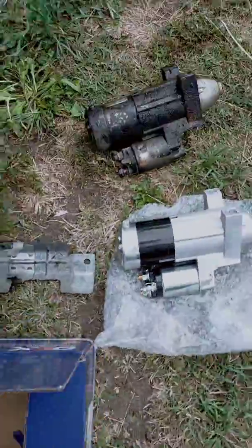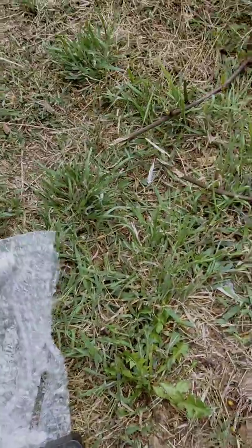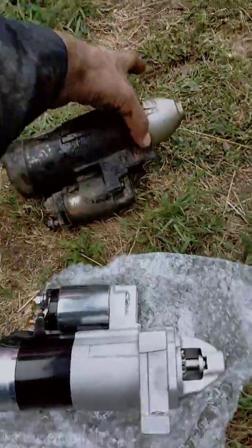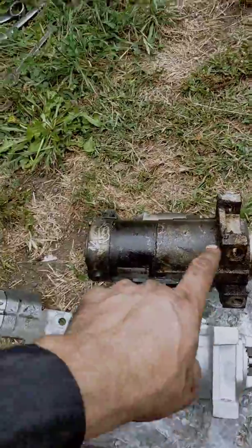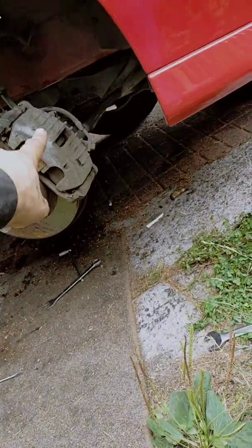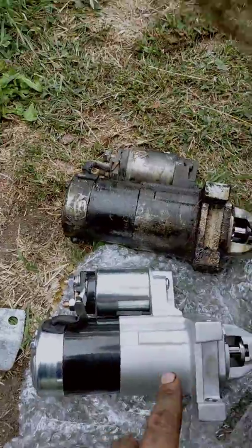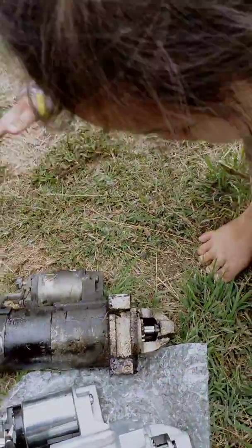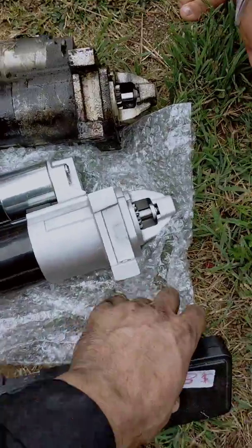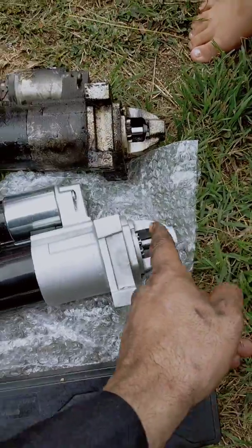A lot of the thing with doing starter motors is how the cog engages to the flywheel. This one's really dirty because the main seal was gone on this, and the person doesn't want me to redo the main seal. Watch out the way, kids. Wonder Woman wants to help. And so usually you shim it to get the right engagement of the wheel.